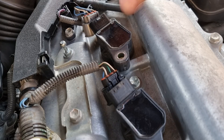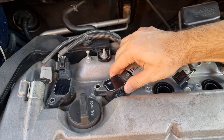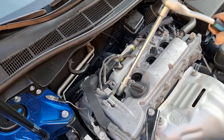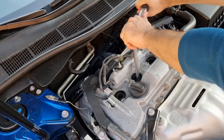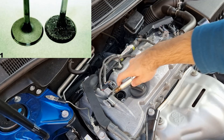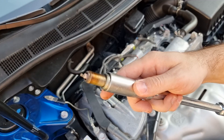If you're asking how do I know I have carbon buildup on this engine — well, you will feel power loss and low mileage. When there is carbon buildup on the pistons, it means there is also carbon buildup on the intake and exhaust valves. When you have carbon buildup on the valves, the engine will lose its compression due to escaping pressure from not fully closed valves.